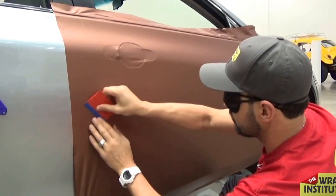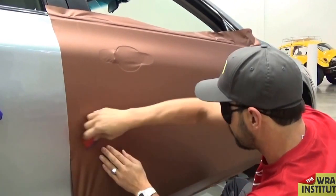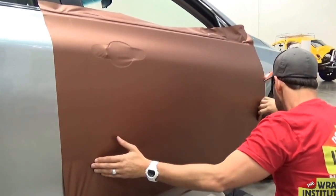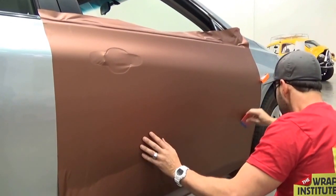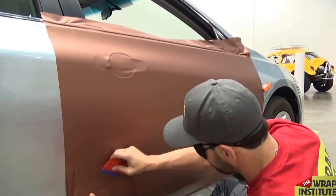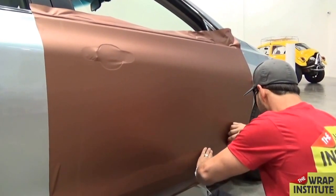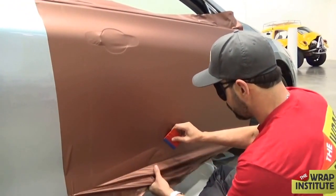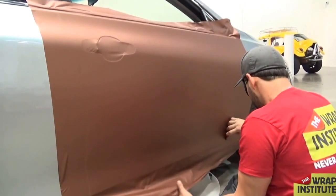Instead of bridging around the door handle, I want to make a relief cut there. I feel through and see a giant wrinkle because of that raised object, so I work it around a little. Once I work it around, I can create glass — squeegee across, catching up and overlapping strokes. Once that top section's done I pull with a triangle towards the right, nice and firm, and I got glass. Getting into a recessed area — minor one — this is very flexible film, so I glide it right into that section. I felt the air pull up, so I stopped immediately, picked it up, released it, and now I've got the angle at the bottom.